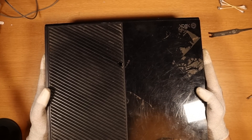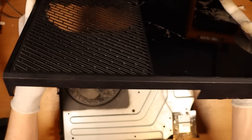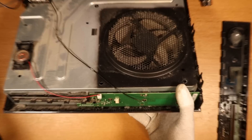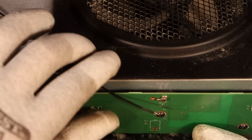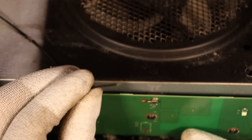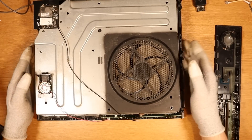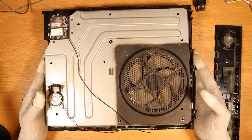I'm going to gently pull up — and I bet the ribbon cable isn't attached. No, it's not. The ribbon cable is here but just not attached. Immediately with this one, I noticed there is a snapped antenna cable, so that will need replacing. If that could be the only thing wrong with this console, that would be three out of three amazing wins. Does this one turn on? There's the chime — eventually it's come on.